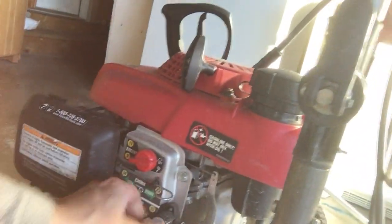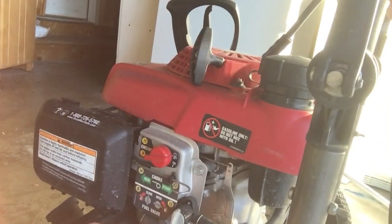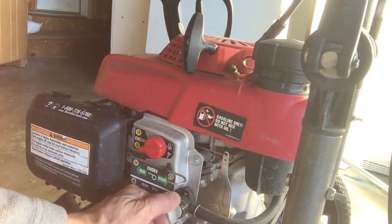If you're having issues, you have to make sure your gas is on. It can turn off. I guess you would use that if you want to dry it out for the winter. I can run my generators and my pressure washer on a really warm day every 30 to 60 days through the winter. Sometimes I'll put them downstairs, but most of the time I'll leave them in the garage, winterize them, and then reuse them. I like to run my stuff because remember, they can get a flat piston, especially on your generators. So you want to run those, not just leave them all year.